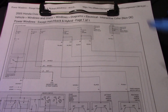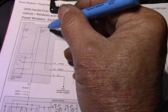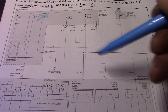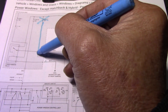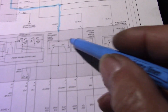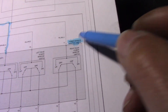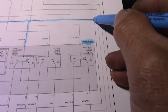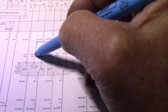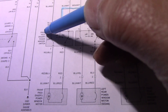I have a wiring diagram for the power window here. As you can see, this is fuse number 22, broken now. Now we follow the wiring diagram to see what circuit this fuse serves. Following this wire after the fuse, and it goes to the power master switch right here by the driver door, and also the circuit goes to the front passenger power window switch.